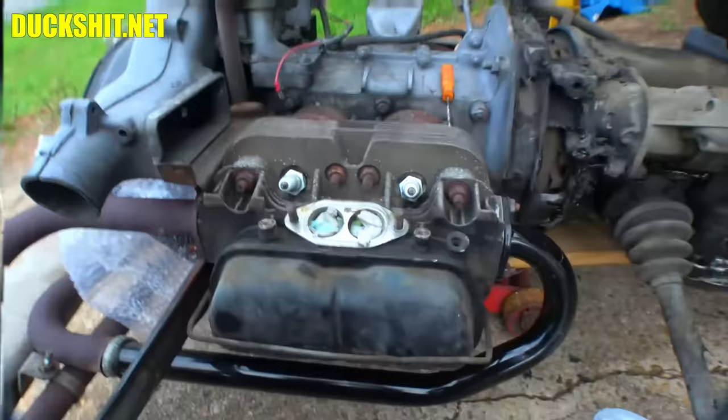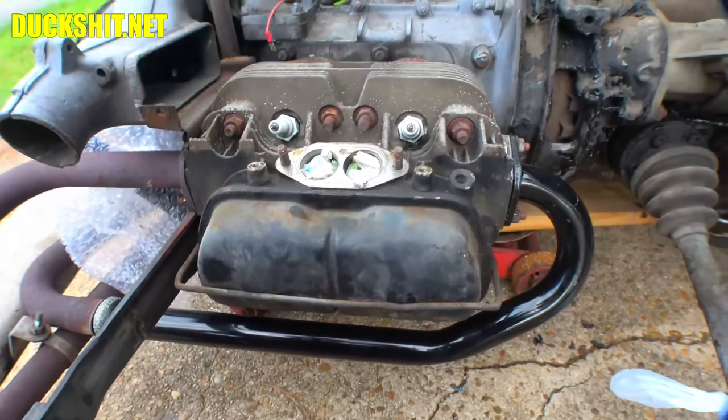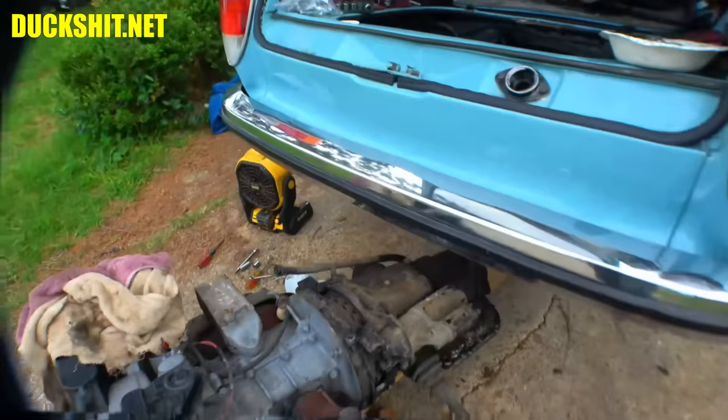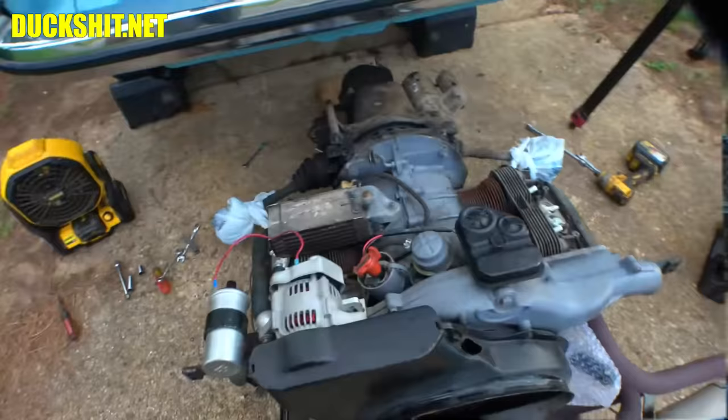Alright, well, we're good up here. It looks like the next thing that needs to go back on is our engine tins. Once we get our tins mounted, we can start sticking on intake manifolds and carburetors. But I might wait to do that until the thing's back in the car, because it's a whole lot easier to push it under the rear apron here. Well, yeah, I might just hold off on that. I guess we'll see. I could yank out the distributor, though. Well, that won't give me any more clearance, will it? No, it won't. So that can just stay then.